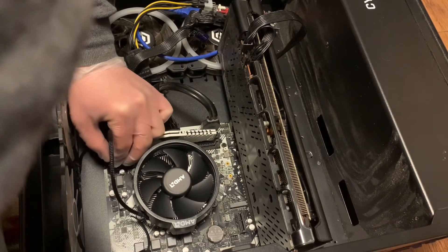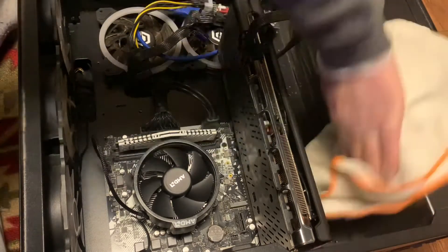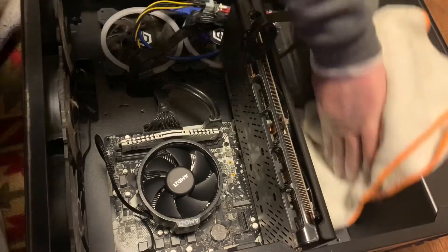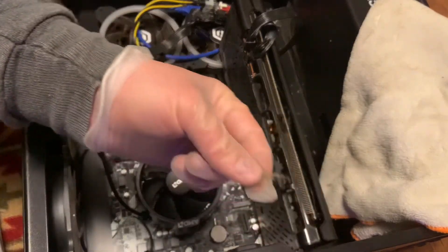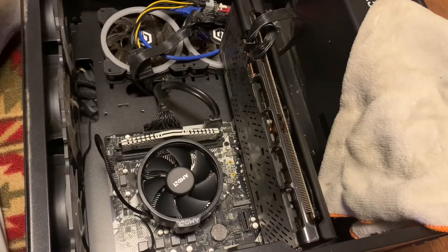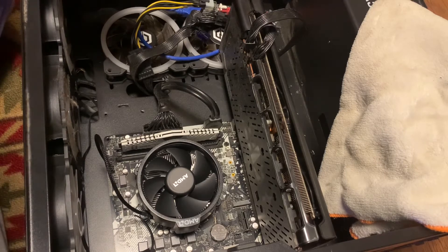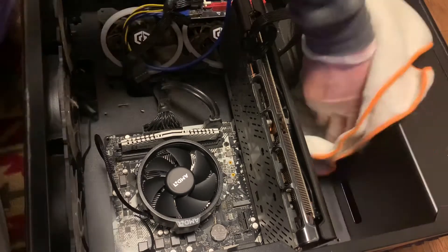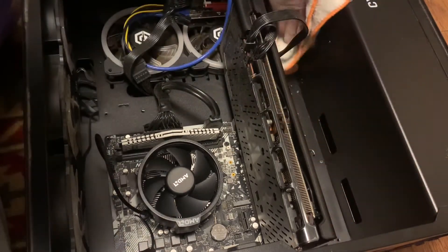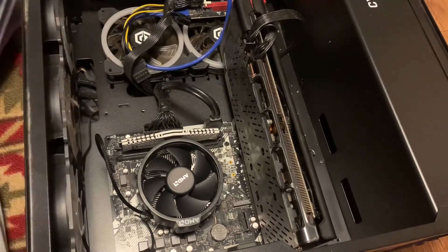Make sure you reconnect the fan. Also do a quick cleanup - as you can see there's a little bit of dust over here. Just use a microfiber cloth and go through it. Some computers are worse than others - look for big clumps of dust like this one right here. If you're doing a full clean, check out my prior videos linked in the description below. When I first got this PC I did a full cleaning because I bought it used and it was very dirty.